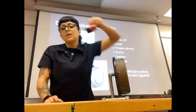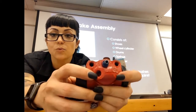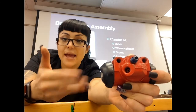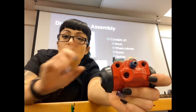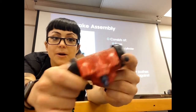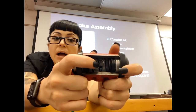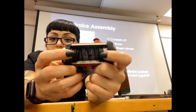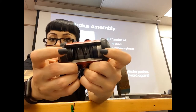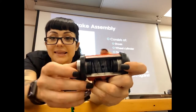Much like the caliper, I've got a hole on the back for a hydraulic line. When you press on the brake pedal, you engage the piston inside of the master cylinder, which creates hydraulic pressure in the fluid, which transfers down a brake line to the wheel cylinder. When hydraulic pressure comes through, I am going to press out two pistons. We've got rubber cup seals in here so the fluid stays in and doesn't accidentally leak out.